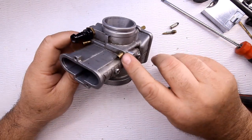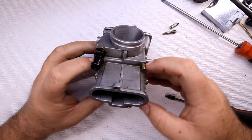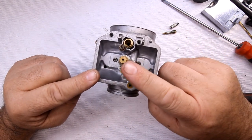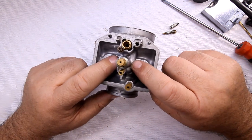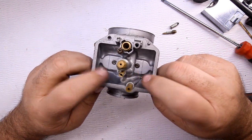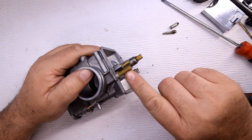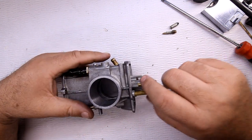You'll see these two things here — this port and this valve on the sides. There are holes in the back right there. Those are just vent lines. Since fuel is being sucked through here, you don't want this to turn into a vacuum, otherwise you won't be able to suck anything out of it. These holes allow air pressure in and keep pressure regulated inside.